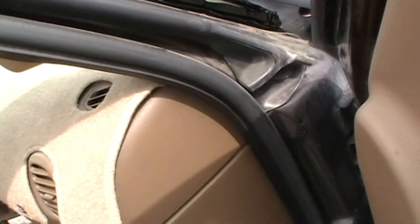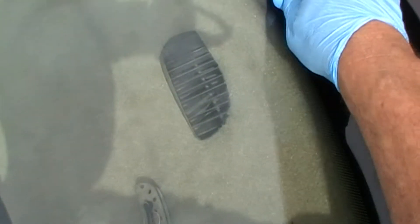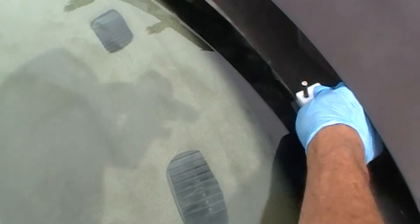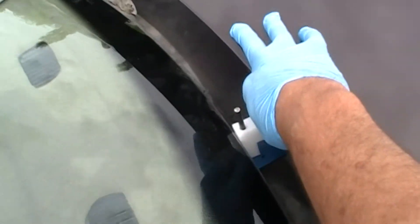Because of the urethane protection rest and the urethane protection cup, the windshield is not touching the urethane — it is completely clear and free, ready for you to swivel or rotate the urethane protection back to a setting block. Simply undo the screw, twist it over, and lower the glass against the setting block. You have complete control. It's pretty easy to do.